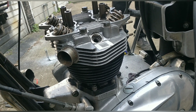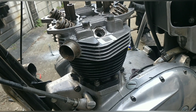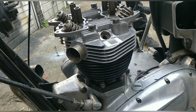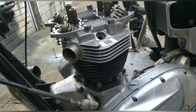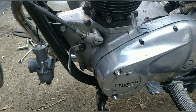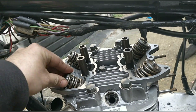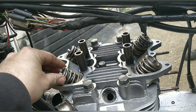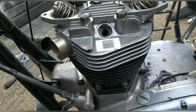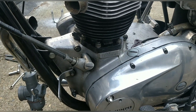This isn't a how-to because I don't have the expertise for this - this is more of a 'this is what I'm doing on John's bike.' The head is down. I feel like I want to spin the engine over. If I pop the cover off I can spin it by hand. I should probably set it to top dead center anyway and set all the valves. I will actually have to do that, so let me get it to top dead center and check there's nothing fouling or any issues with the compression.